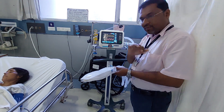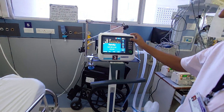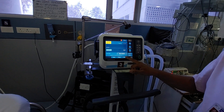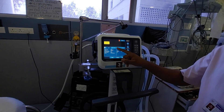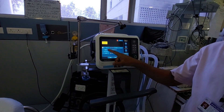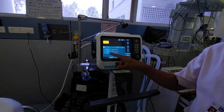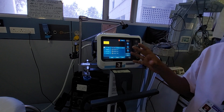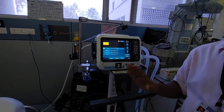First, take the machine to standby mode, then go into the System menu. In the system you can observe 'Test and Calibration' — there are three options: Tightness, Flow Sensor, and O2 Cell. Go into the Flow Sensor option. The machine will give each and every instruction; you have to follow the instructions only.